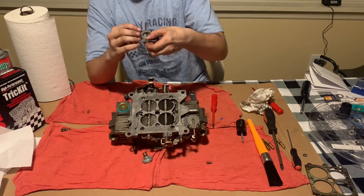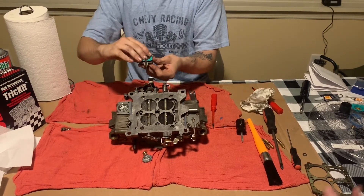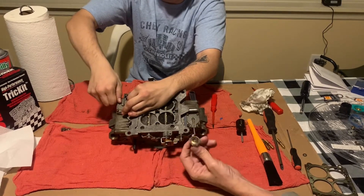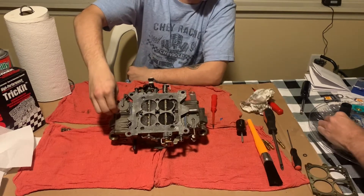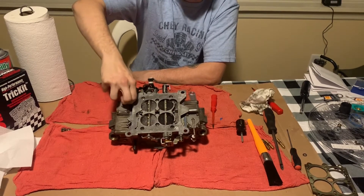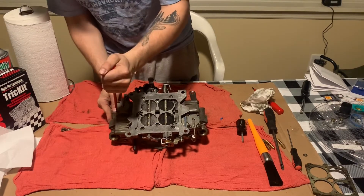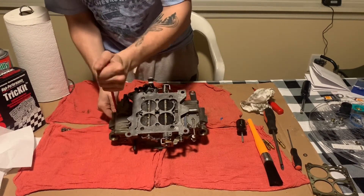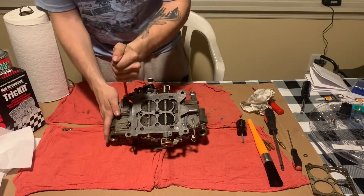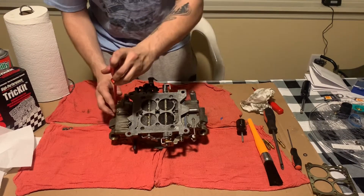Same thing on this accelerator pump — I'm going to line up all the screws into the housing, then take my gasket and line it up with these screws, and then line everything up with the rest of the accelerator pump. I'm going to tighten them up in a cross pattern to get a good contact surface for that gasket. I'm taking extra special care to make sure that these screws are tight, because especially the one on the driver's side — this accelerator pump was the one that was leaking. So I want to make sure that these are secure.